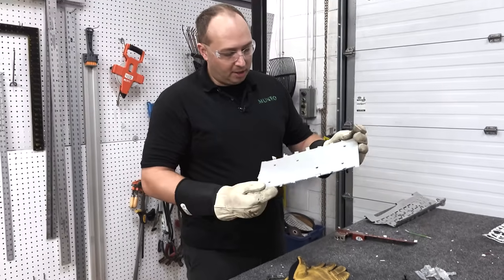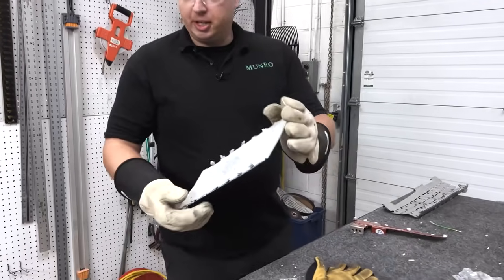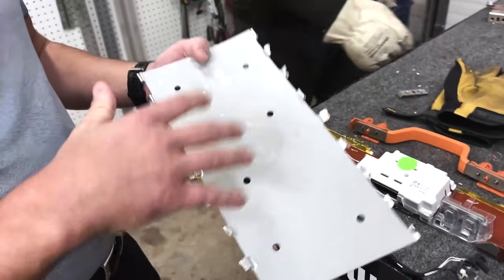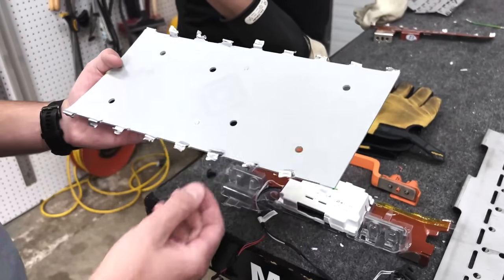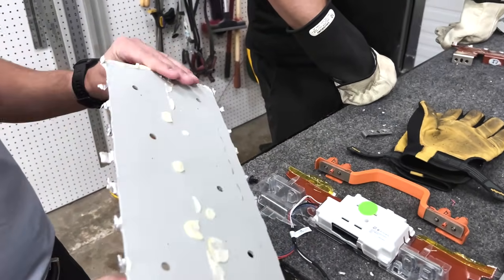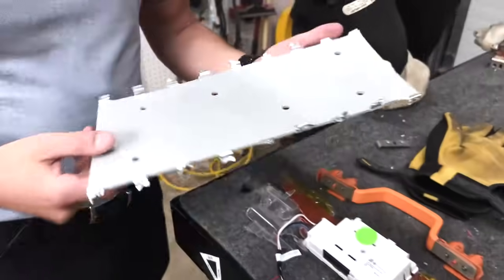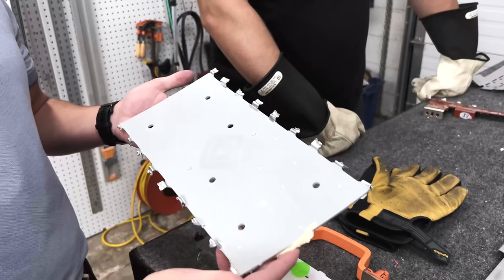On the other end of the module, we have a bus bar system connecting the top and bottom half in series. The key point here is that it's overmolded. The bus bars are sort of acting like a current collector, reaching across two different bricks within the module. Where you do not want metallic exposed or electrical conductivity, they're just overmolding it with — this looks like PA66, glass-filled 25% as noted on the material here. The overmolding makes it easier to handle, reduces the amount of fasteners and intra-current-collector attachments. Relatively simple, but it makes it easy to assemble.